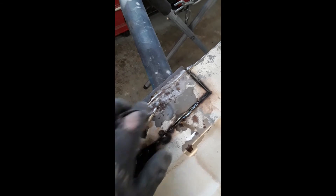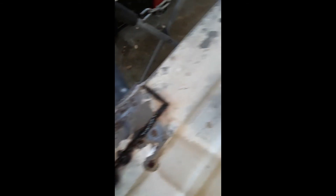Put it in, spot weld, cut a bit more — if you angle the grinder down. We call it a scarf joint in carpentry almost — it's not quite as close as that, but it's the nearest thing I can liken it to. You can see the old panel is still in place and I'm spotting down here. Pull that out now and the panel is virtually in position without much need for it to move. I'll spot it up — it doesn't look very pretty, but there's good penetration, it's quite a good weld repair. I'm starting to clean it off, it doesn't look too bad. I'm making it up as I go along.